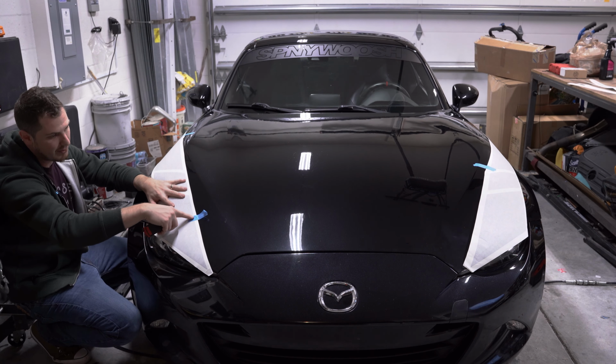So this crosses over onto the fender right about there. And looking at the wheel, that's about the same as well. Let me go ahead and measure the rear tip to the door handle, 3 inches, imagine that. And then here to here, yeah, that's about 2.75. So that might be a little too far in. Yeah, it definitely is, just from seeing the two tips and inside. So I'm gonna try to move that over just a hair. I assure you, this will take a few attempts just to get right, but you don't want that to be off.